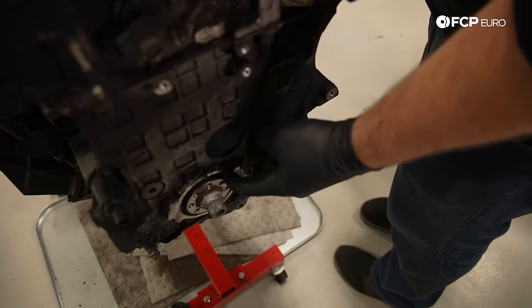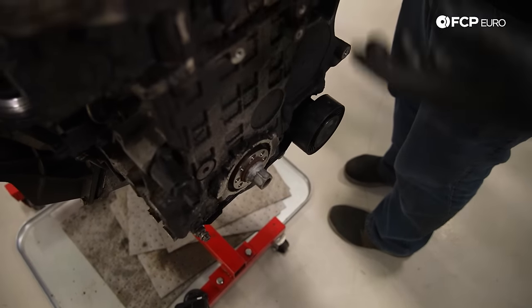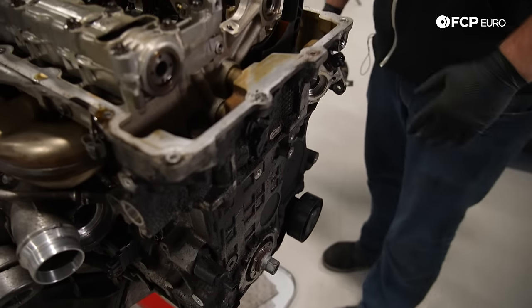And we talked about that ad hoc on the N52, N54, N55, N20s. Very important that if you do have an oil filter housing leak, take care of it as soon as possible. Don't let it become a huge problem. Just because of the design of the engine, it'll cause the serpentine belt to swell because oil will fizzle in on it. Once the belt swells, the tensioner can't deal with it anymore. The belt has nowhere to go but backwards between the harmonic balancer and the front main seal. And then it gets ground up and pushed in through the front main seal. And then you have a huge problem on your hands from that point forward. So never neglect it. Take care of it immediately as soon as you know you have that problem.